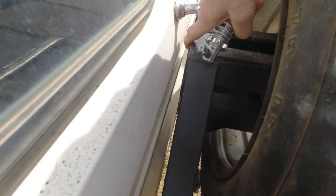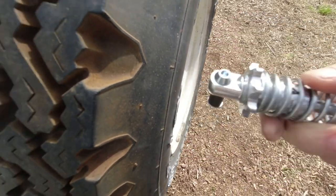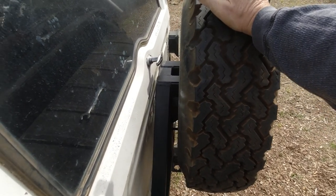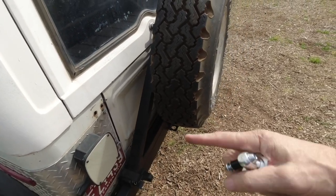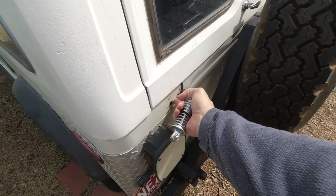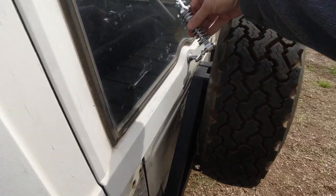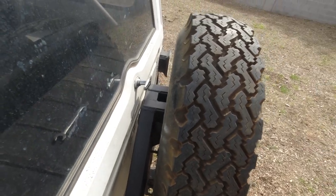I'm going to mount that back in there between these four posts, and it's going to stick back with a rubber bumper on it. I'd like it to compress about an inch — I've got at least one and a half to two inches of travel — and you can just compress that when you pull the tailgate shut. These tailgates are really stout; I've had a full-size refrigerator sitting on this tailgate. For those saying that's a stupid way to solve it: that's how Jeep solved it originally. They had a rubber bumper pressing against the sheet metal at the bottom, which is what I'm going to do.